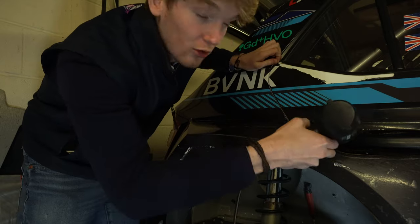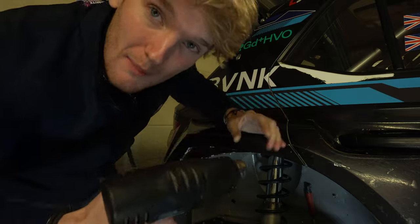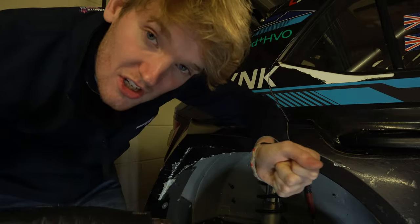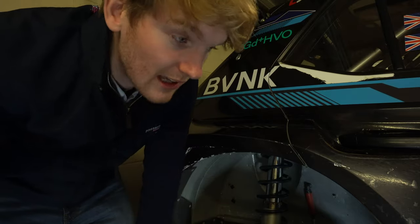We're going to be trying to heat down the door so we can continue the process without stopping. If it starts to rip and break off, that means we haven't heated it up enough. If it's stretching and some of it's staying while you're losing parts as you go, you've heated up too much. You want to be somewhere in the middle so we can keep everything going together — that way we have less chance of leaving little bits behind that will stay sticky and messy.